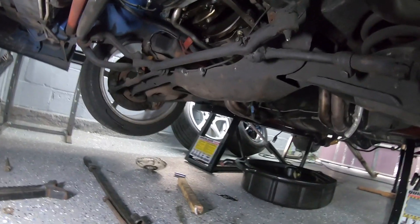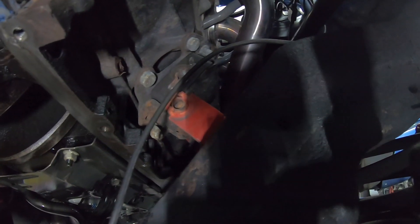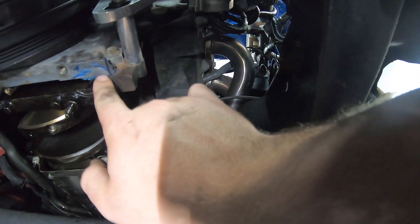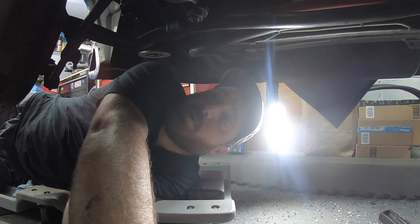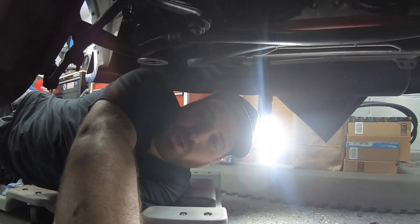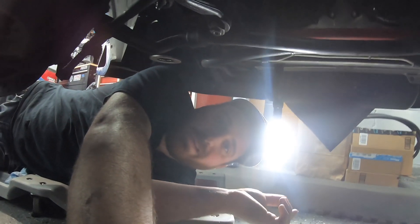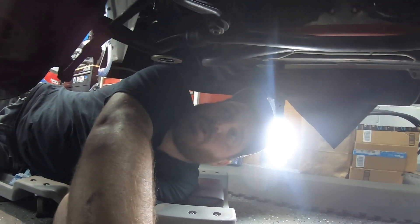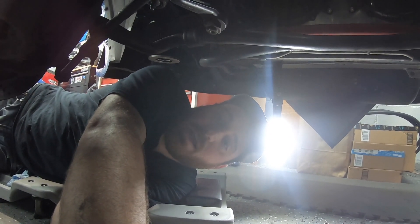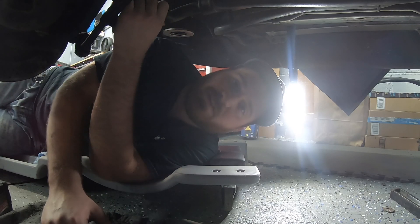So I could have just slipped the gasket out by dropping the pan down far enough, but the original gasket that came with the pan is actually riveted to it, so I have to break those off to get the gasket off. But as far as the engine support bar goes - totally worth the money. Look at how high this thing got lifted up - there's the motor mount, there's the mount on the car - it was definitely not getting that high with just a pry bar. I just have to come in here and clean off the RTV at these seams before I put the new gasket in. Going to end this one here, get this cleaned up, throw the pan back on, and next video we'll get to work on the scatter shield. With the oil pan changed and the clutch disassembled, we can get the backing plate for the scatter shield on, notch it with the grinding wheel or plasma cutter, and then get the bell housing on and the transmission back in. Remember to hit that thumbs up, share the video, don't forget to subscribe, and I'll see you in a few days.